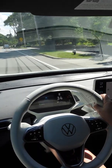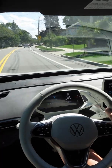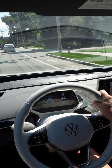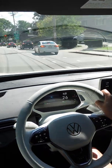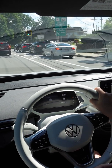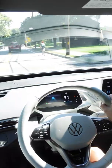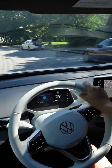It sees the car — you can see the blue indicator. Blue means it's active. Let's set it to 40, which is too fast for the traffic ahead. As it catches up with the cars in front, it's going to slow down. We're down to 37, 36. There's a red light ahead, so hopefully it will come to a complete stop. Unfortunately, a pedestrian interrupted the demo — I had to hit the brakes because the car didn't see the pedestrian. That's actually a good demonstration of a limitation. Resuming now with target speed 40, but it won't reach that. It's going 30 because it sees the traffic in front, which is exactly what you want.